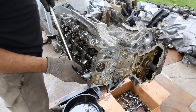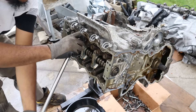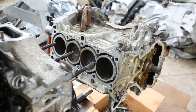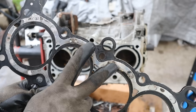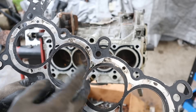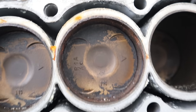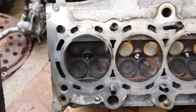This engine is so simple it's already time to take off the head, using 14mm 12-point sockets. One bolt was also loose, so I'm going to say cylinder 2 head gasket. Now as soon as you turn the head over, you can see there are burn marks here and here — indicating a cylinder 2 to 3 head gasket failure, allowing the coolant and combustion to mix together, and then you run out of coolant and overheat. Check out all the crusty stuff inside the water jacket and the rust marks in cylinder 2 and 3. Compare it to the other two cylinders — these two inner ones are clearly different from the outer two which look more normal.